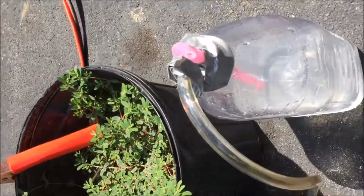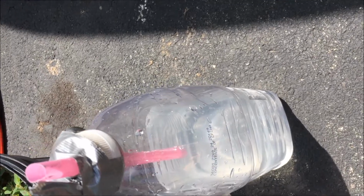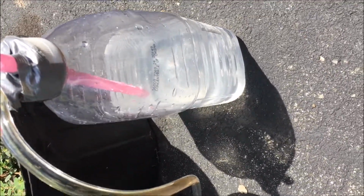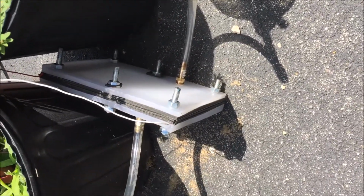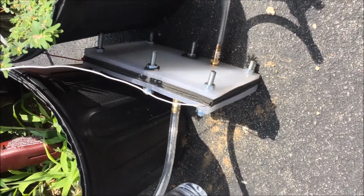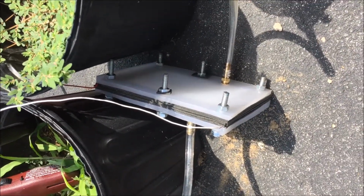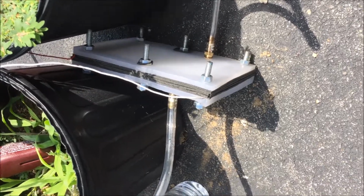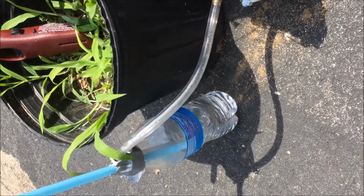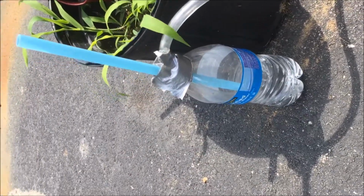It had two holes on top, so I just had my hose connected that goes there, and a straw go down into water. So when I flip it over, water's not going to come out the straw, but air can go in. That way, it doesn't suck and make a vacuum on the bottle. It's going to flow into this, and then electrolysis happens from a 12-volt car battery on 6 plates, 2 volts per plate. And it should turn it into hydrogen oxygen, which will take it to my bubbler. That hose goes down into the water, and that straw does not touch the water.